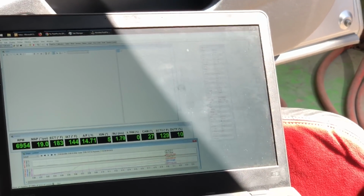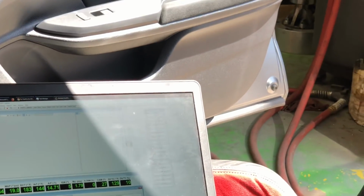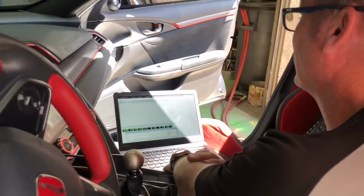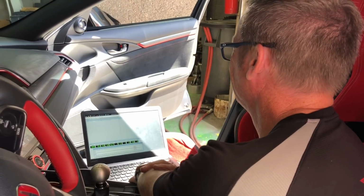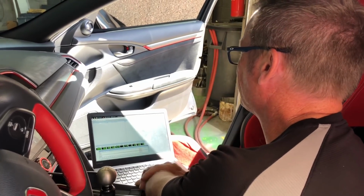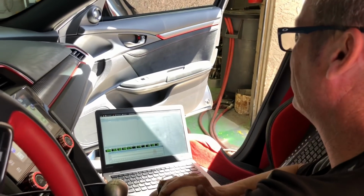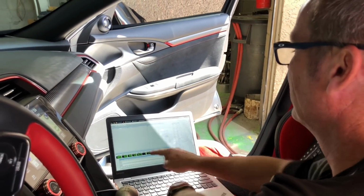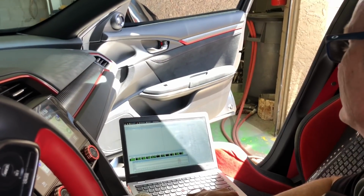Wow. So when they're saying that, you know, do a flash, you get 30 horsepower extra, what would be the differentiating factor? If we could keep the intercooler cool, maybe some ice on it or something, so that not midway it starts to gain temperatures. What we would really want is to hold that 106 or barely pick up to maybe 110, 115. We didn't really want almost a 40-degree differential from coldest to hottest. Gotcha.